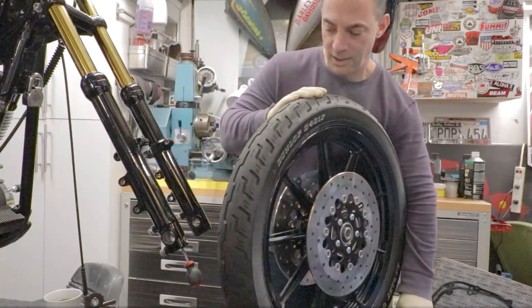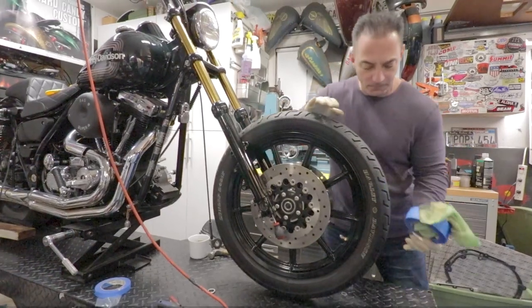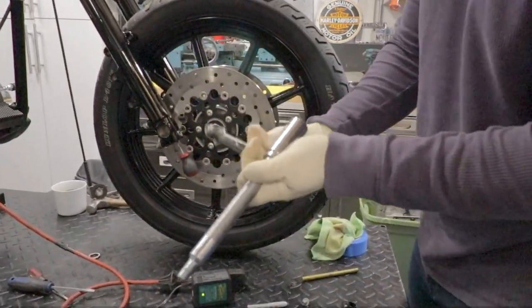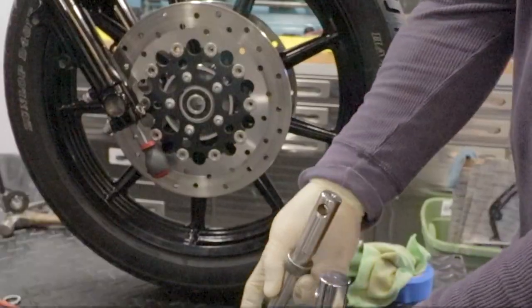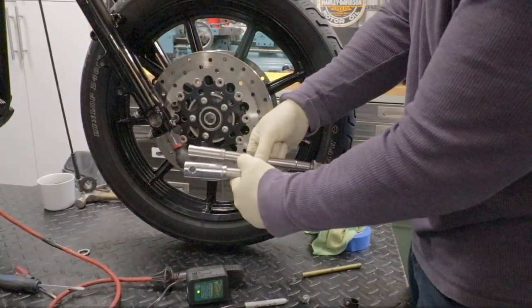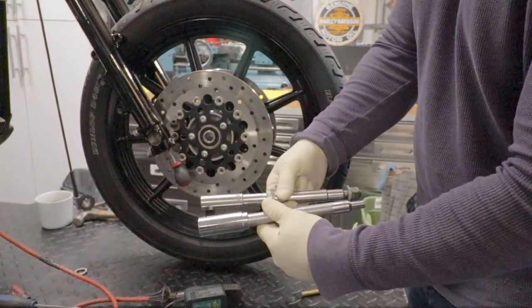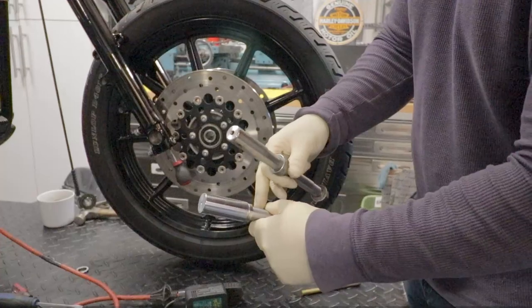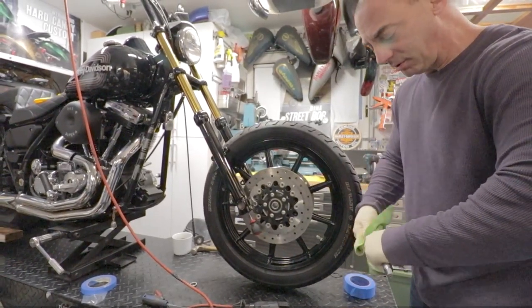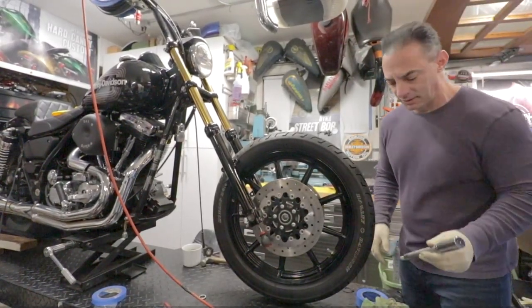Johnny spent the last couple of hours machining this axle. The stock axle looks like this, but because the thick end of the new axle goes into the fork leg and the original was a lot smaller, Johnny threw it on the lathe, knocked it down, and made it straight across. So now we have a 2000-and-up Dyna FXDX axle going through older 1988 Timken bearings with a custom axle. Johnny also made a little spacer. Great job — it looks fantastic.